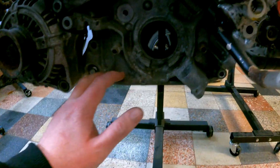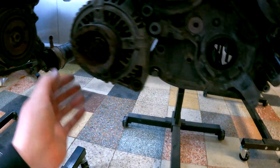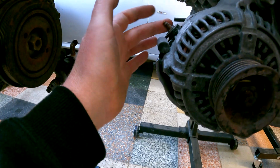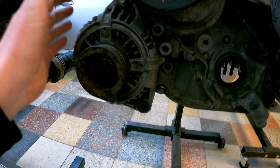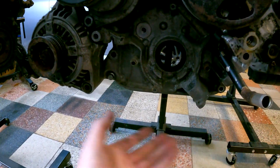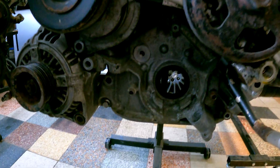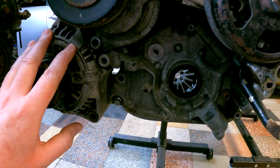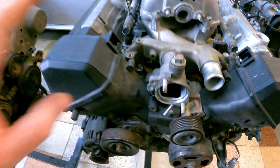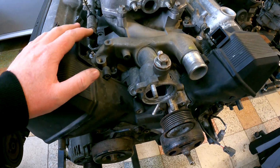Now, when you're doing an IS200 Altezza swap, that main harness underneath here has the main power cable for your alternator. Now that cable, funnily enough, or luckily enough, is actually the correct length, and it has the right angled tip that goes directly into your fuse box for your IS200, IS300 or Altezza. So with that particular harness underneath there, we don't necessarily need the whole harness.